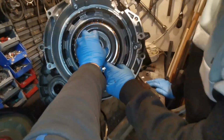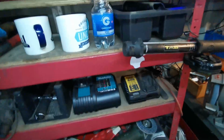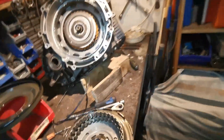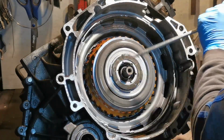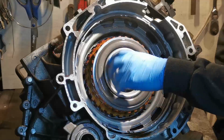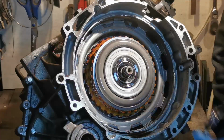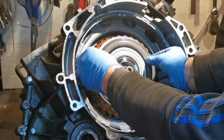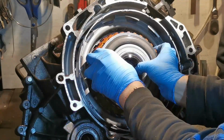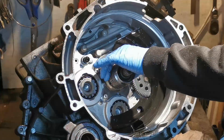Now this thing has to come off. This screws on, so just use a screwdriver. You've got a screwdriver there, and here's the hammer. Bit of a rag. Yeah, there is a tool that opens it up, but obviously this channel is DIY, so do it yourself. If you're doing it for the first time, I doubt you're going to have the tool. So now the whole thing pulls out, and you've got the oil pump and whatever else.